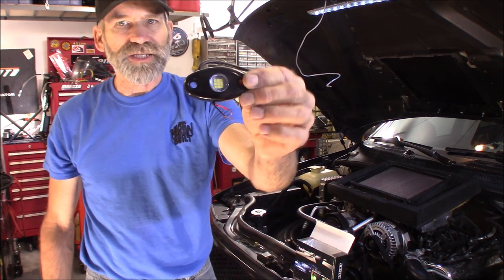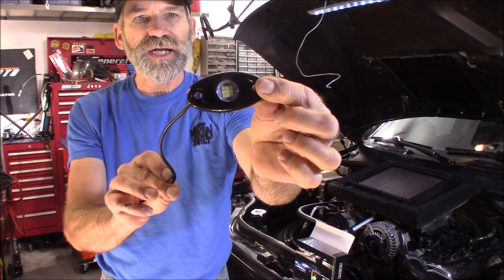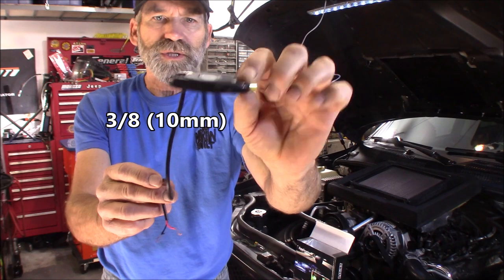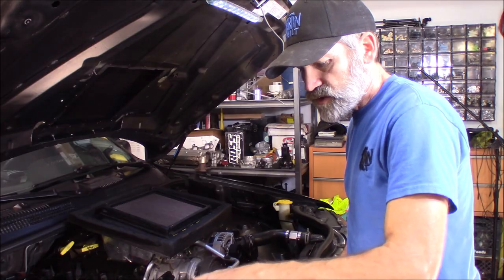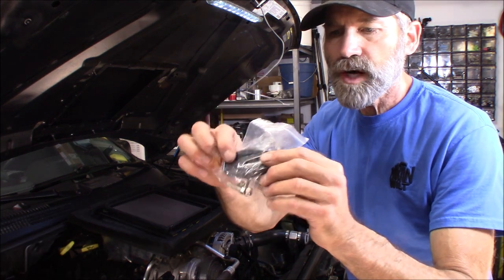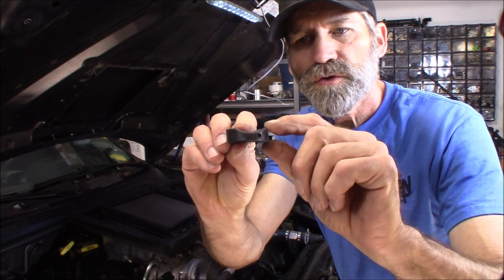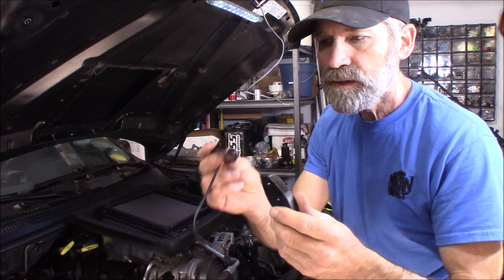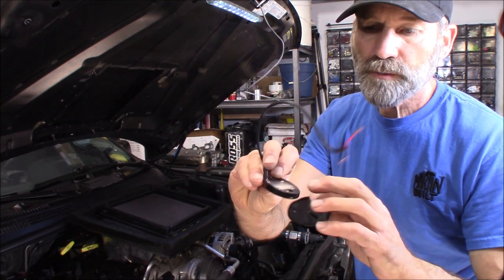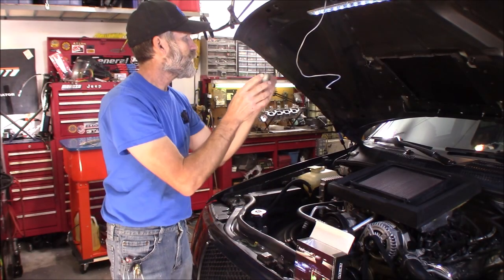These are actually meant to be used as rock lights or to illuminate the underside of your four-wheel drive for rock crawling. These are very bright — they have 9 LEDs. I love how thin they are, about three-eighths of an inch, 1.37 inches wide and just shy of 2 inches long. These lights come with a rubber grommet that fits behind the light, for mounting to a roll cage, giving that rounded concave feature. It's a die-cast aluminum housing — no plastic — so it's durable. It's also waterproof, all sealed and epoxied in the back. It's made to be underneath your Jeep or four-wheel drive and put up with some abuse. It fits perfectly up in this spot right here.